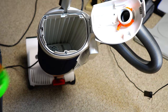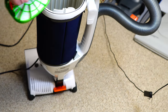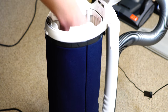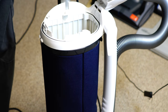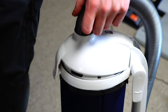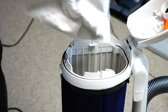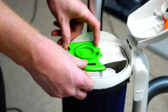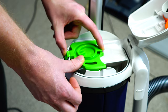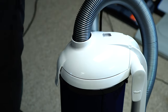You can see the actual motor is mounted at a slant inside the machine. There's also a relief valve next to the motor: if something gets jammed in the hose, it opens up and prevents overheating or burning the motor. A metal clip prevents the machine from running without a bag installed. When you insert the bag, it drops in easily and covers that tab — so the unit will only run with a bag in place.